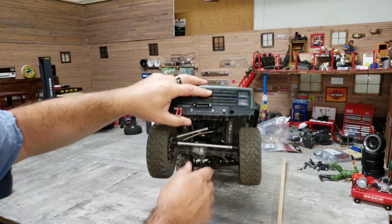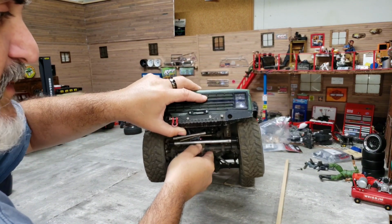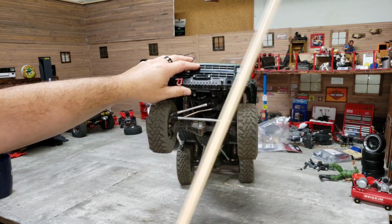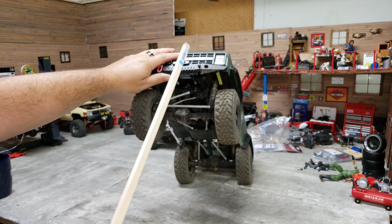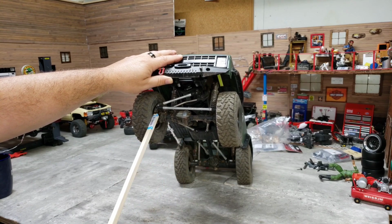It's very nice. The suspension's very nice in this. Not really any bump steer with this. It doesn't float around on you. Their suspension setup and the three link and the panhard bar work extremely well. You've got your panhard right here. So since we're into the axles, we'll get into some of the suspension.